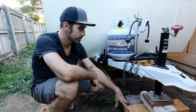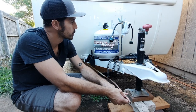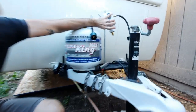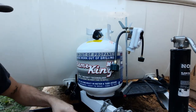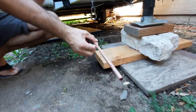This is my copper propane line — it's 3/8 inch outer diameter. The propane copper tubing here will connect down here with the flare fitting on the regulator, and that of course connects to my propane line that goes down underneath the trailer.